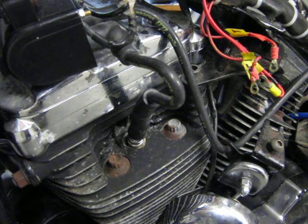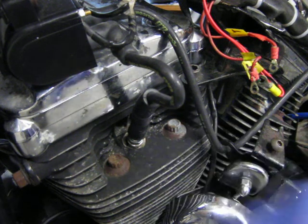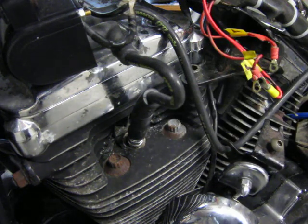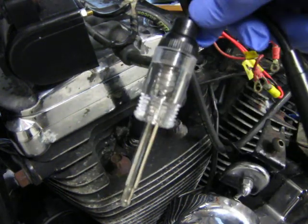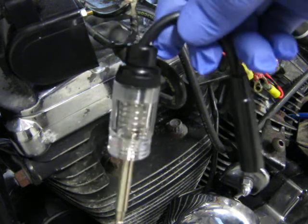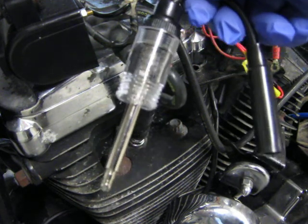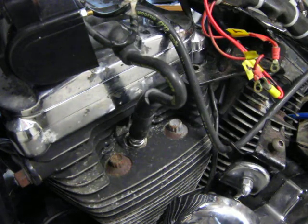He's got a good point, so I'll be following his comment. I'll be getting the rear cylinder spark plug, putting it in the front and swapping them over, just to make sure that I'll still get the misfiring or non-sparking front cylinder. I've got this spark plug spark tester this time — it's fairly cheap, I think I only paid about $15–$20 for it delivered. This will let me make sure about the spark.